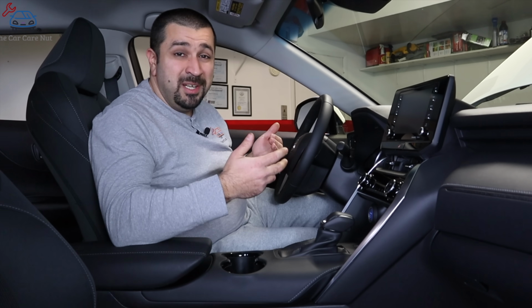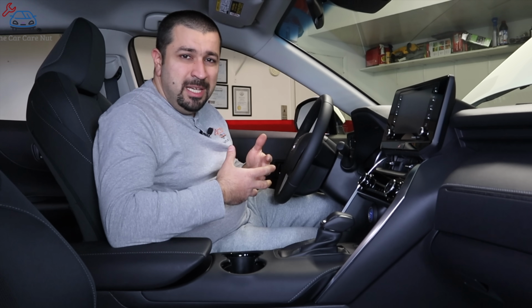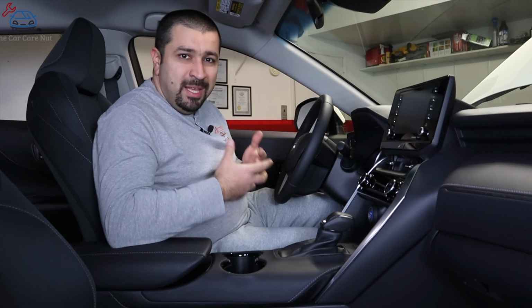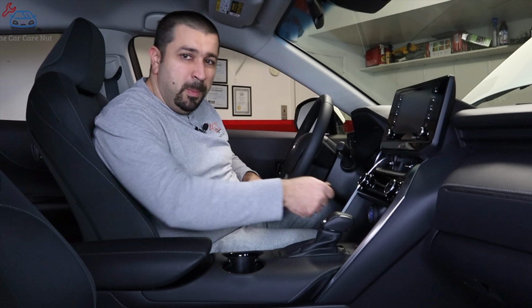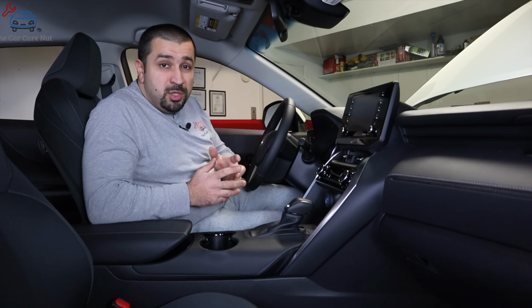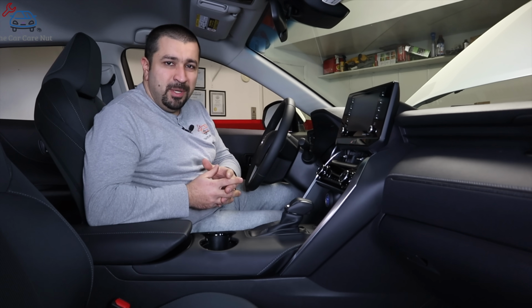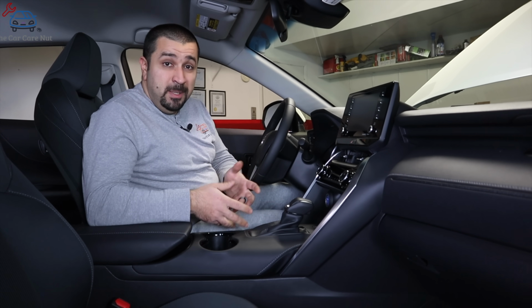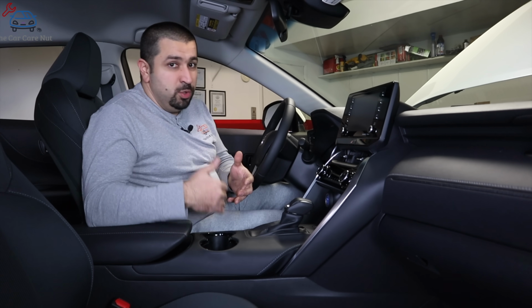Folks, there are no gears in hybrids. It's all computer software doing this. It is essentially the same as B mode or brake mode, that's what the B stands for, but it gives you varied levels of it when you go plus and minus on your transmission. So use B mode when needed, when you're going down a hill at highway speeds and you really feel like you're going to fade your brakes, then use it absolutely.